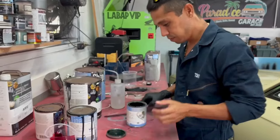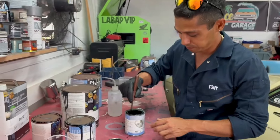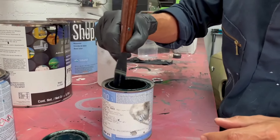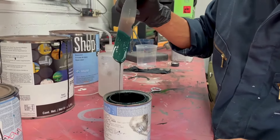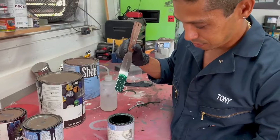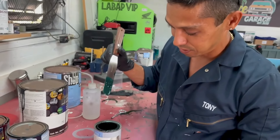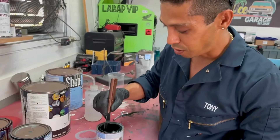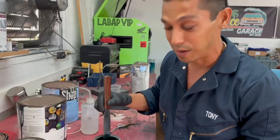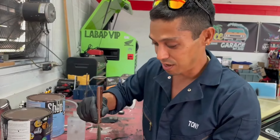Let's show you a proper base coat mixture. This one — that's an ugly green — but it's already thinner. We might have to add a little bit of reducer to spray it. Let's count it again: one, two, three. It's a little thick, but a lot thinner. This is actually almost sprayable. I would add just a tad of reducer and you're ready to spray.